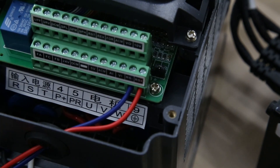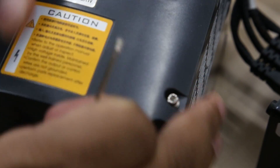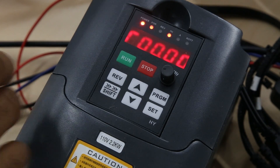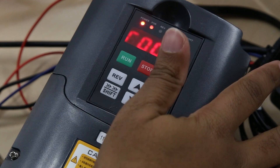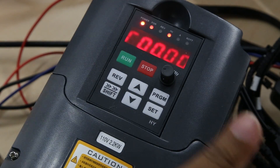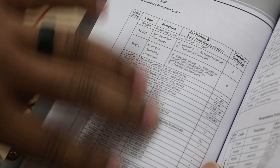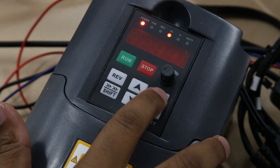That's pretty much it for that part — no extra wiring needed. Now we get into the configuration of the VFD. We're going to set the values inside of here to make it communicate with the breakout board and the controller. I'm going to give you a bunch of settings — if you're ever wondering where they came from, they're in the back of the manual, starting on page 19, giving you PD 0002 all the way through the other settings. I'm just going to go through the ones you actually need.